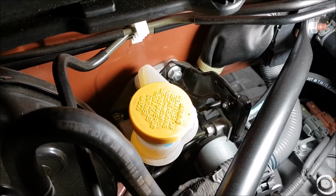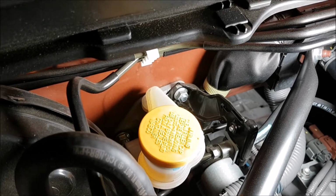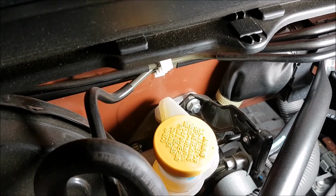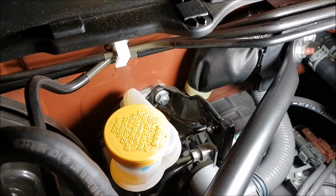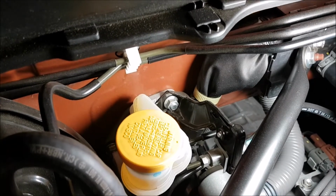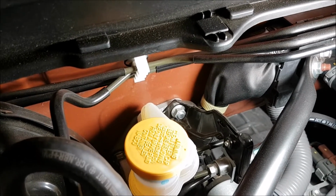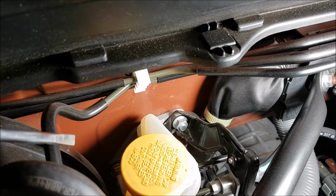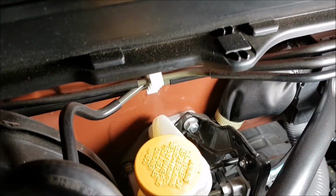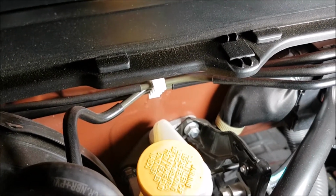That's where that tape comes in handy. So put the tape in your socket. I'll show you how to do that in a sec. Pretty simple. But yeah, that'll hold that nut in your socket when you loosen it off so you don't drop it and lose it. That little rod that had the clip and the pin on it, that must come through into the clutch cylinder there somewhere. So yeah, that stays in there. That's why we need to undo that to get that clutch pedal out.